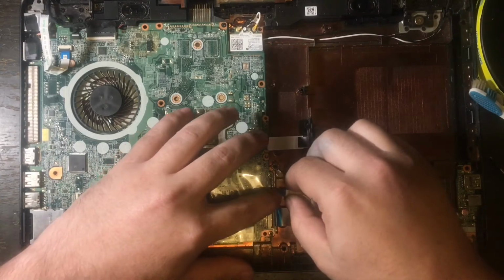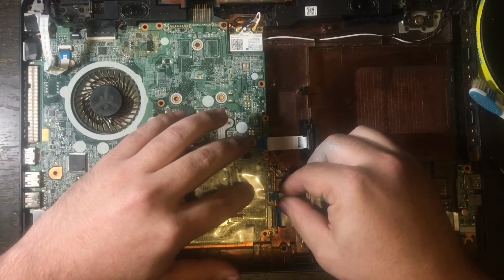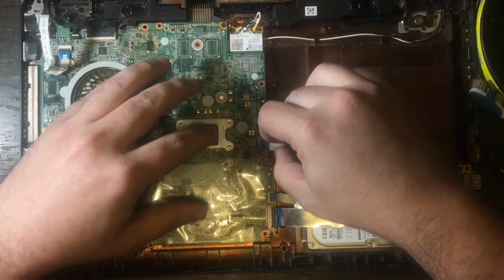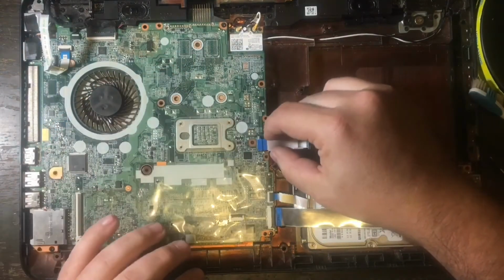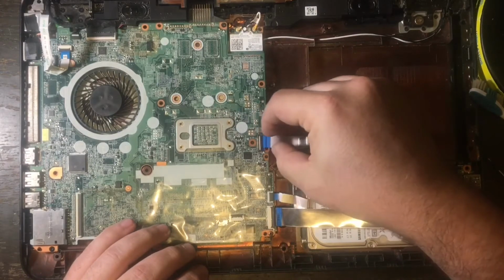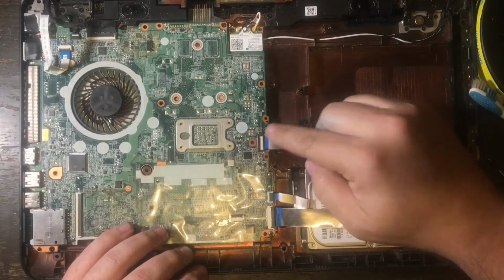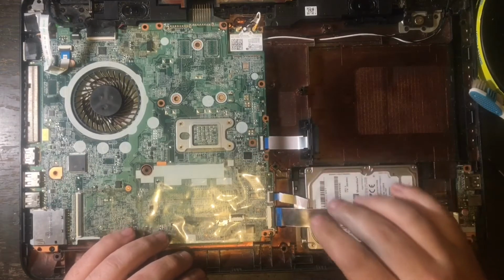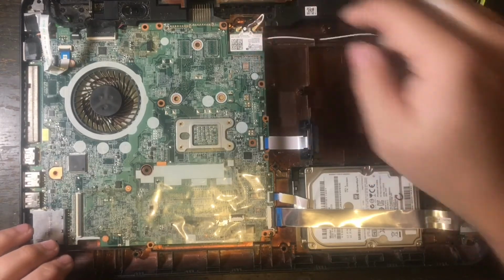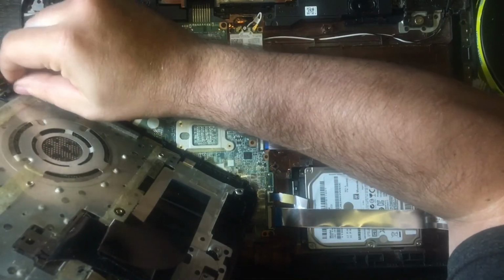You want to make sure you put them in snug and accordingly, that they fit right, and then you're going to want to push down that plastic retainer tab. And they only fit one way, and you'll know when it's in if it's tight and snug, and then you're going to want to push down that plastic tab. You're going to want to do this with all of those cables. I'm testing to make sure that the Wi-Fi antenna is plugged in good.